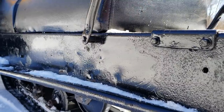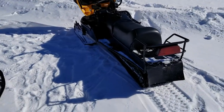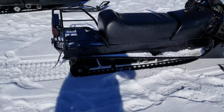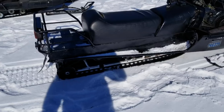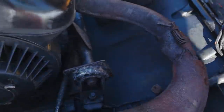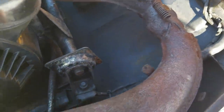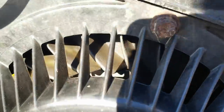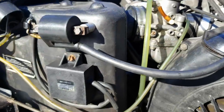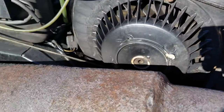It's got that nasty cancerous rusty stuff on there, so maybe we'll redo that. I've got a whole other tunnel for this that's mint, but it's for the leaf spring one. We'll see - maybe I'll sandblast it. She's been trailered, that's why there's rust like that - either trailered going ice fishing or ripped up and down roads with salt on it. I could tell by that bolt there she's been in a nasty environment. I knew it was running lean - I can hear it popping in that exhaust.